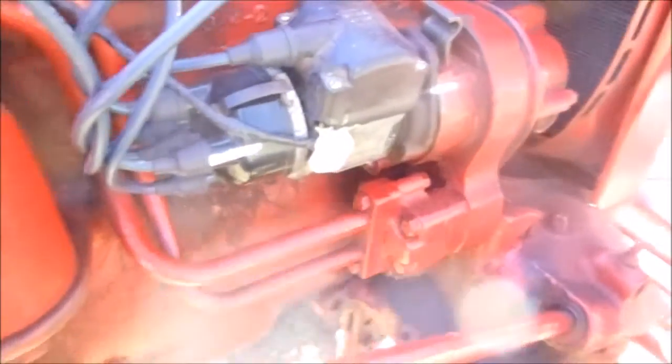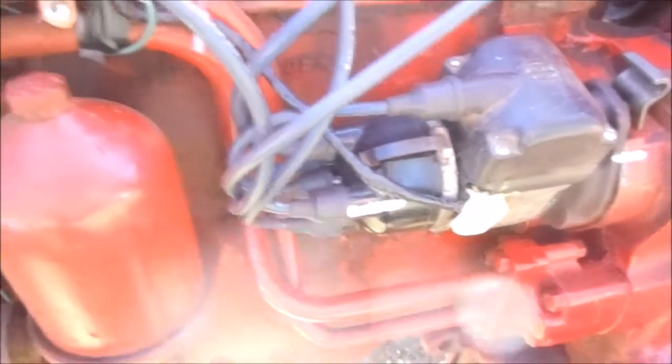So anyway, everything is perfect other than that though. You see I got this marked perfect top dead center, number 1 cylinder. Like I said, the engine's running good. When she starts, she runs good. You see I tidied up my condenser thing I showed you in the earlier video. Condenser wire coming out of here, she's all sealed up, condenser's up there. She's got a cover on it. I'm going to put a rubber cover on the whole thing, so if weather gets bad I don't have to worry about it, but I'm not concerned about that right now. That condenser job worked out perfect.